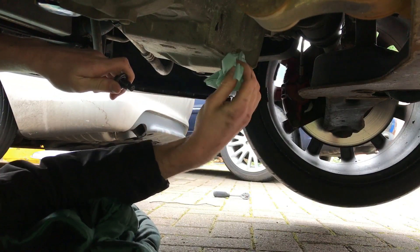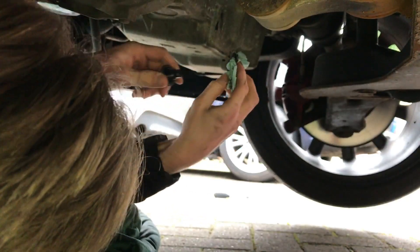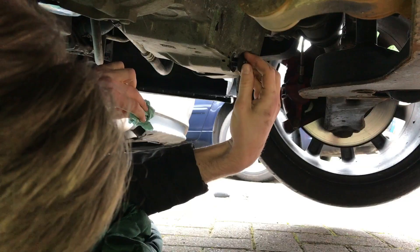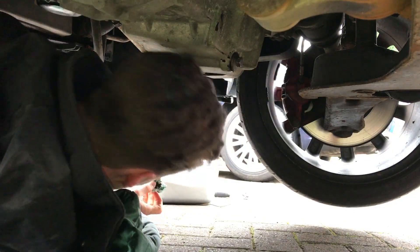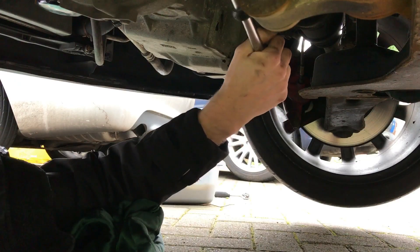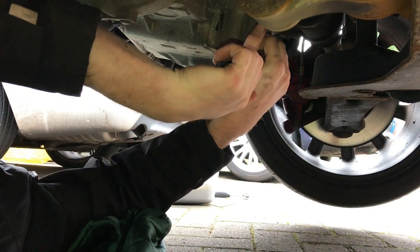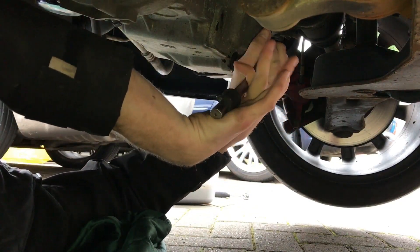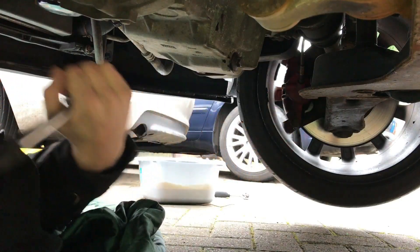Back to it - there's a pool of oil on the floor now, great. Just wipe it around, and then put the plug back in. Make sure it threads in nicely, so do it by hand first and then tighten with a socket. I looked it up online - it was 18 foot pounds of torque. The way I do it is get to hand tightness and then do about half a turn or quarter turn, just till it's snug. You don't need any more than that.